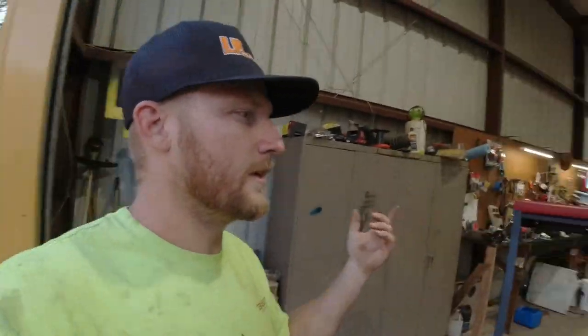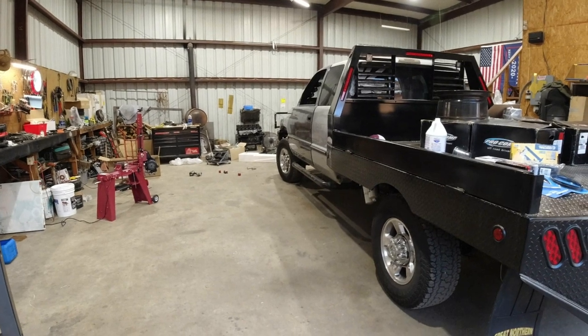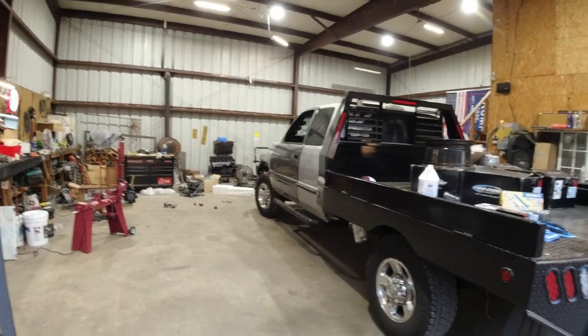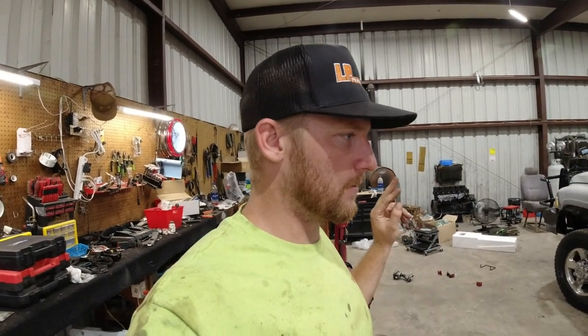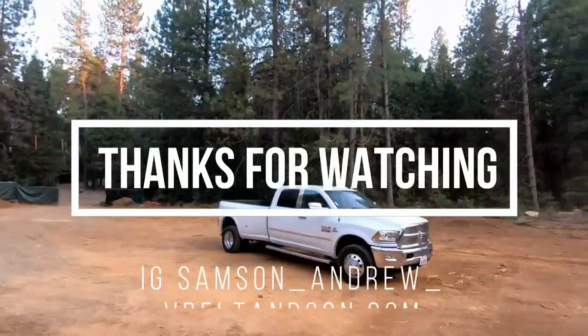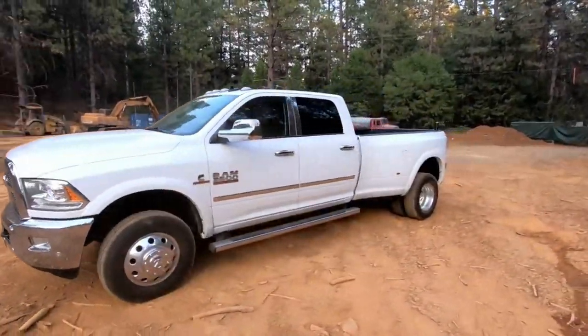In a couple of weeks when I go pick up grandma and get my enclosed trailer from the trailer store in Winnemucca, I'm going to bring grandma back and take her for a ride in her truck before it gets painted — just so she can see it in this state and take her for a ride while it's running. I think it's mean — it's got a really mean prop to it, a good tone. P-pump 24 valve is definitely something I want to pursue in other trucks later on. A '97 truck for my state — these are smog exempt and hopefully they stay that way. We're going to adjust the timing and see if that straightens anything out. I'm going to call Power Driven Diesel, maybe get some different injectors and push tubes. Try that out and check the timing. Like, comment, subscribe, share this video — ask your buddies if they have experience with it. Until then, we'll see you guys on the next one.